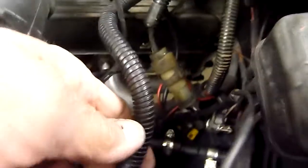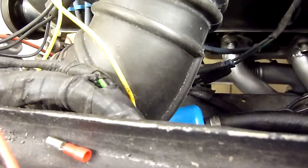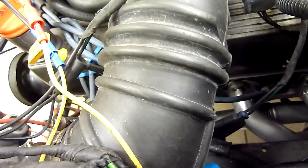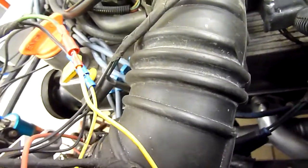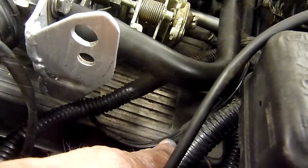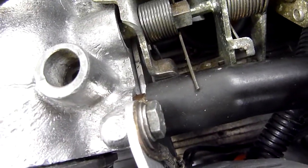Going over here - it's under the wing of the car, but there is this cable. It goes on the back of the airflow meter; it's got four wires and there's a huge plug - you can't get it the wrong way around in theory. Now, one important thing with these looms: the computer does like them to be earthed properly. There is a treble earth wire which I've put onto this bolt so it's properly earthed.